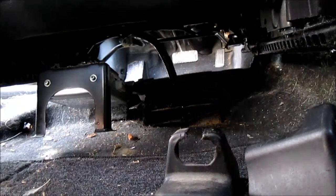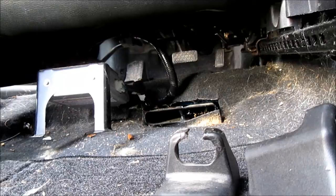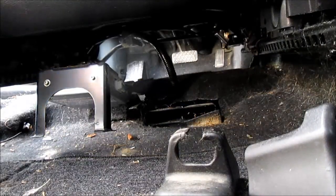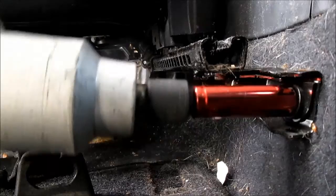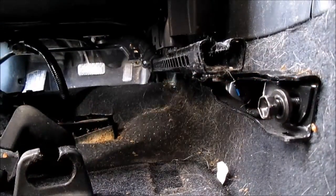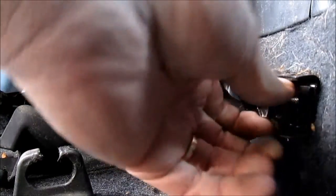All right, that's what I thought was gonna happen. I gotta move the seat back up a little bit. There's two bolts back here with 14 millimeter heads on them. One there and one here. That one there goes sideways. These little covers on the bolts just snap off, snap back on. There's little clippy-do things in there to hold them. I didn't use that the first time.